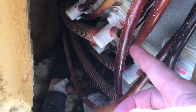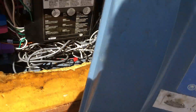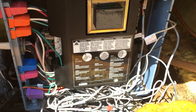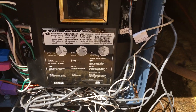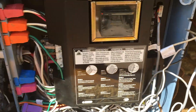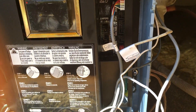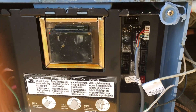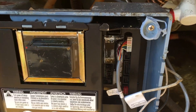As you can see here, these lines are still filled with food-safe antifreeze from the winterizing. We're going to take off our electrical box — it just has screws on the bottom and top. We're going to make sure all the electrical connections look good, that no wires are frayed, and that no water has gotten in and started corrosion. Corrosion can be seen by oxidization of the copper wire, which leaves a white residue.